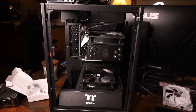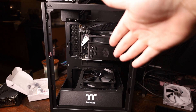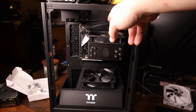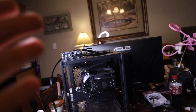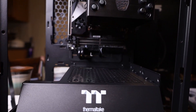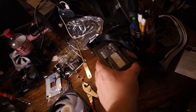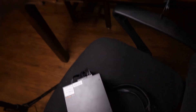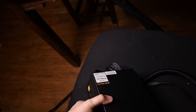All right, so we had a little complication with the cooler. I'm not going to use the AIO — I went ahead and got a Cooler Master one instead. It's only a Ryzen 5 3600, so it should be good enough. Anyway, this is a mess, but I've done all the connections. The only thing left to do is put in the power supply. I was going to use the 850W Titanium, but I'm going to go ahead and try this ATX one — it's 650W Gold. Since she doesn't play heavy games and won't be overclocking, it should be good enough.